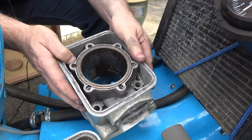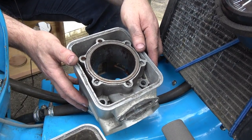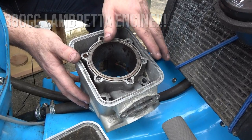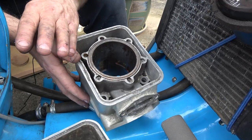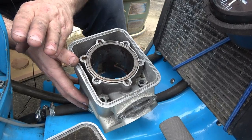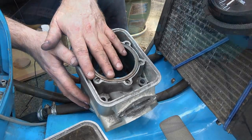We're slightly down on stroke — running it on 72mm stroke because we physically can't get any more into the space available. The plan would be to produce a crank where we can reposition the crank pins, so we can easily use the same forging to go from a 64-stroke crank to a 72-stroke crank.